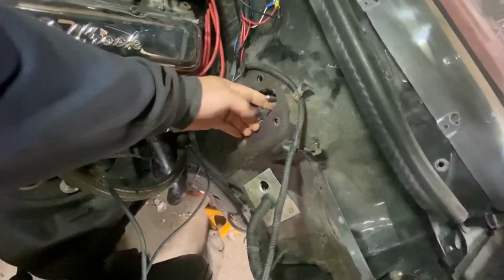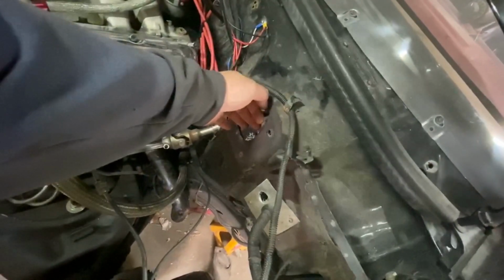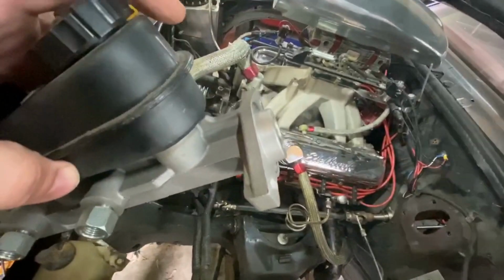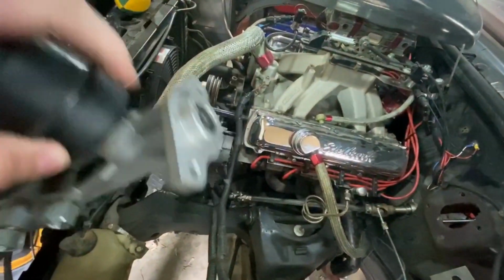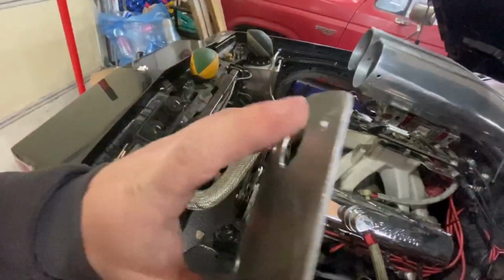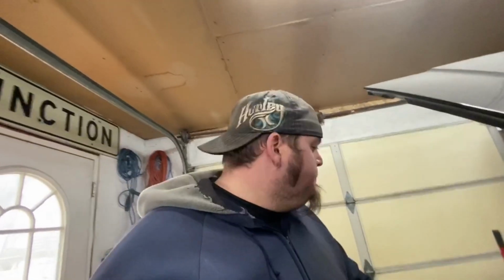This is the rod sticking out of there. There's actually not much sticking out. Maybe half an inch of rod, a little under half an inch of rod sticking out past the firewall. But this guy goes flat up against there now without putting any compression onto the cylinder. And actually, I think I went a little too far, because once I put the plate on, I am going to lose this thickness of space. But that is why we use the bolt. It's threaded. We have an adjuster, so let's back that thing up into it.